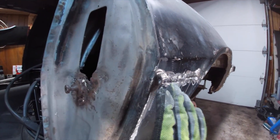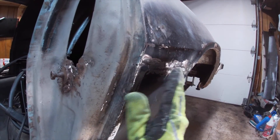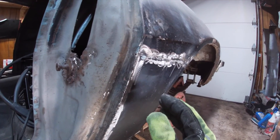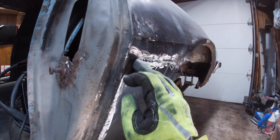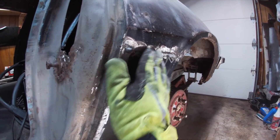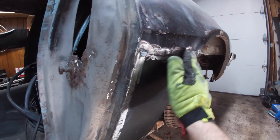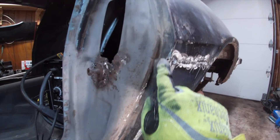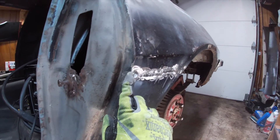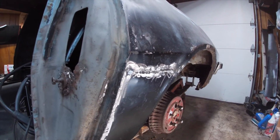All right guys, as you can see, we've actually got this pretty smooth. We just don't want anything popping out. So when we add our really thin coat of body filler, it doesn't get in the way of this metal when we start sanding it all down. So everything's looking pretty good. We'll come back and hit this all with the grinder, get it as smooth as we can, and then fill in any spots we need to. There's some little gaps and voids that I want to fill up. It's always best to fill it with weld than to fill it with Bondo or body filler.